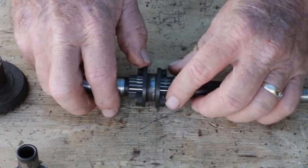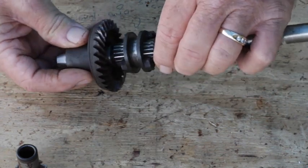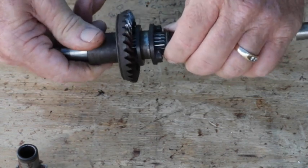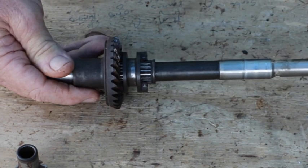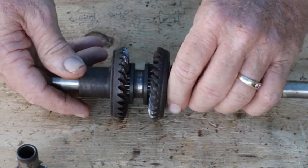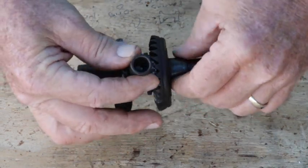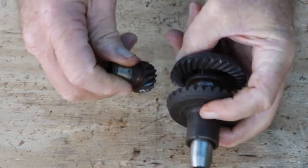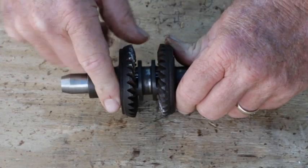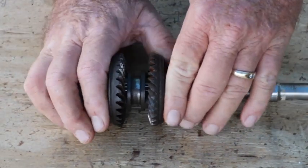When you come off neutral you go this way — if the forward gear was on here, it's got these cutouts in there and when you hear a grind that's that rake engaging against that when you're trying to put it in. Your reverse gear goes on this side. The pinion gear spins both gears at the same time when the motor's turning, and the clutch dog pops one way or the other and engages whichever gear you're going into.